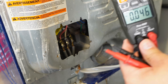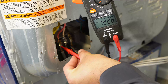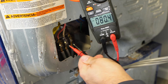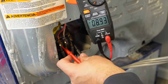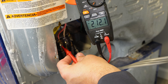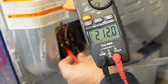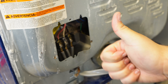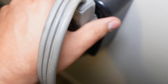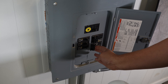To test and confirm that you are getting voltage to the terminal block, use a multimeter and set it to voltage AC. Use the two leads and press them on the block. Center to left should get 120 volts. Center to right should get 120 volts as well. Then left to right should get between about 208 and 240 volts AC. If your unit gets much less than 208 volts or one side gets under 120 volts, electricity is going to be your issue and not the unit itself. This could be an issue with the power cord, outlet, or simply that the breaker needs cycled all the way off then all the way on.